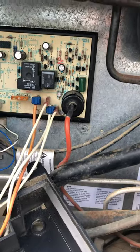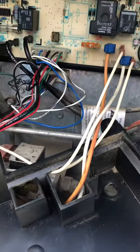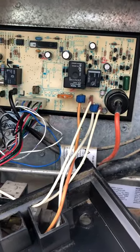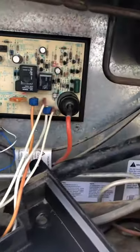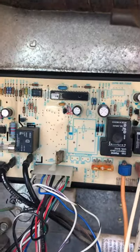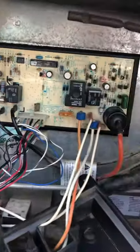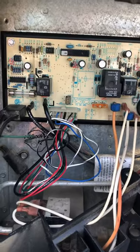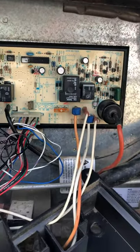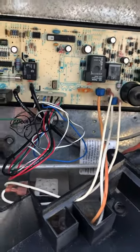Then you go back in, turn off the fridge and then turn it back on. Hopefully that resets everything. And if not, you read the code again. My code started switching to one beep every three seconds — and that was the thermistor code. So originally mine was beeping five times, which means it's not cooling. The whole point of this reset is: it was not cooling, so I needed to reset it to get the correct code. I did all that and reset. Then it gave me a code blinking once every three seconds — which, if you look at the very beginning of the video, you'll see what they all mean. That was indication of a thermistor.